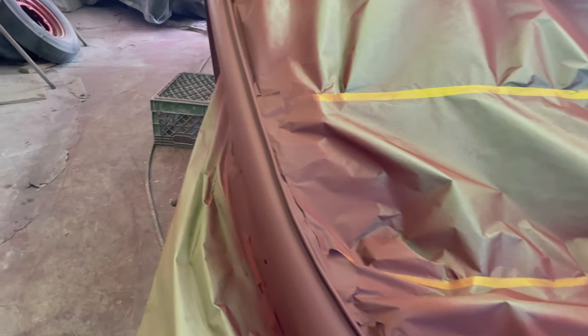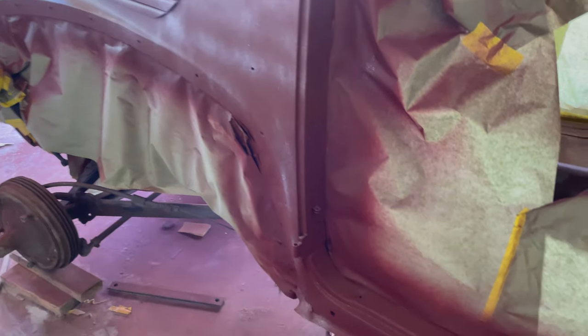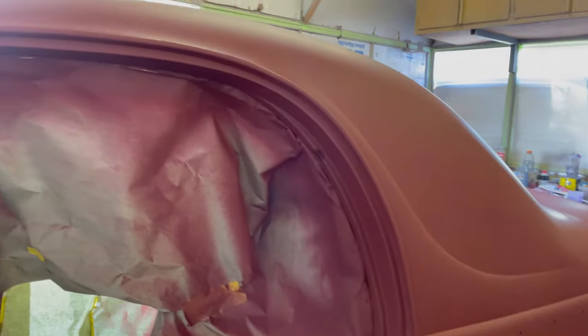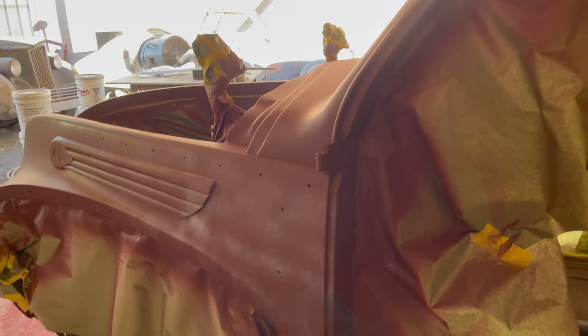So this is really, really close. How many layers of primer do you use altogether? You probably put on 10 or 15. You sand off at least 10 or 12 of them. You really want to keep it very, very thin because it's unstable, and if you get it real thick — and there are some primers, especially lacquer primers, that are famous for being unstable — so we don't use any lacquer primers. You've got to use a material that is actually going to set hard and stay that way for a number of years.